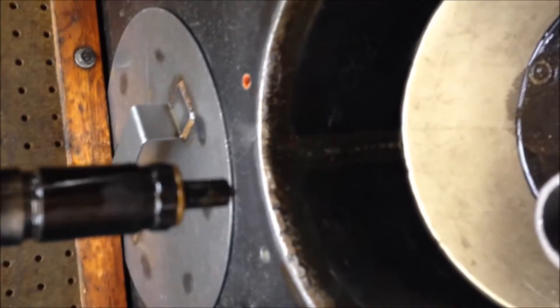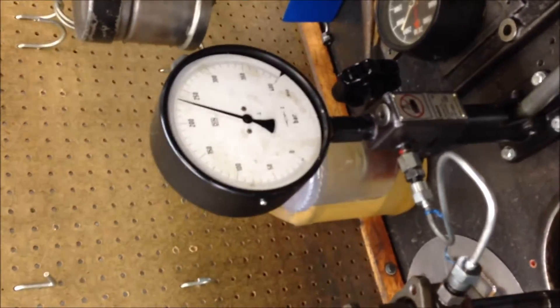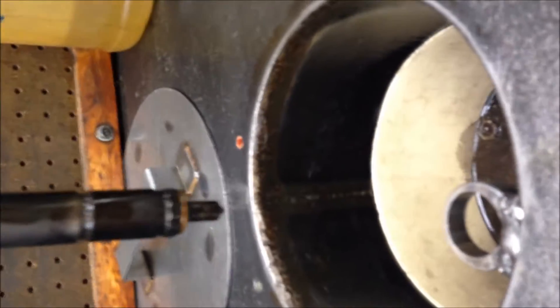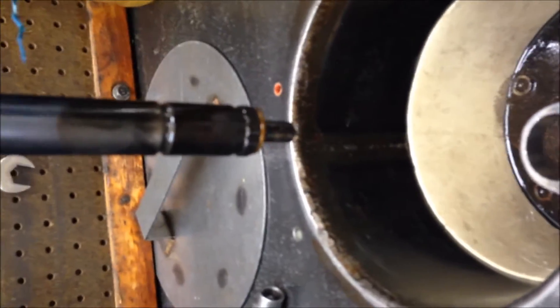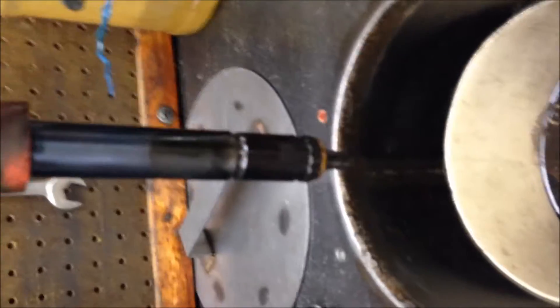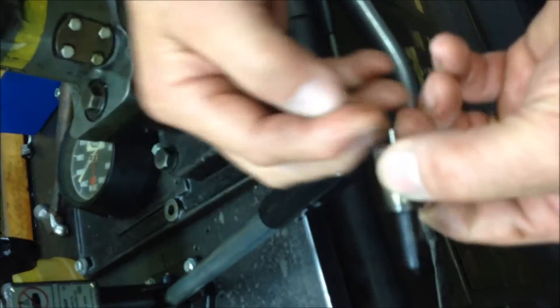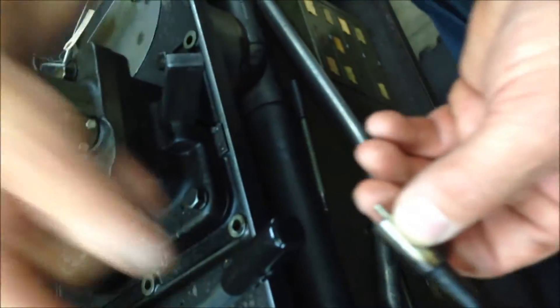About 250 bar. A little high, but that's probably where I would set them. See, we're not leaking off, we're not dripping here — that means that needle valve. So what do you mean when you say that's where I would set them? Well, it calls for 225 bar and they're about 240 to 250 so far. But that needle valve seat right there is holding, so putting 250 bar to that little hole right there — it comes down and picks this needle valve off its seat. So once it starts to atomize, the pressure drops a little bit, the springs and everything in it jam that needle valve back on its seat. That's when we're hearing that chatter, that popping. But yeah, that one looks good.